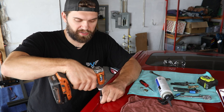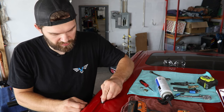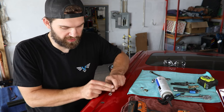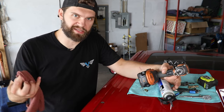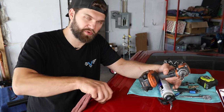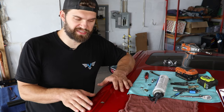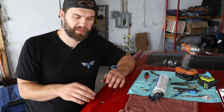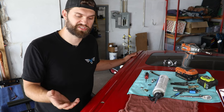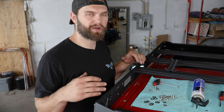With ours seemingly tight, we're going to back this out and get the tool removed. You can check your work here and clean up any excess RTV for now, as we will add more into this location before we get the spacer and bolt installed. If you have any concerns as to whether you have that fully seated, you can always put that socket on a ratchet and check by hand to get a better physical feel for it. Then it's just a matter of repeating that whole process on the remaining seven holes to get all your rib nuts installed.